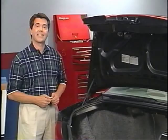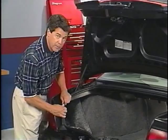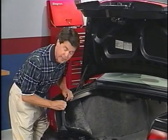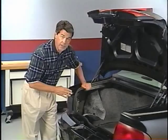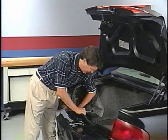Another less likely cause for water in the same area would be an incorrectly seated trunk weather strip seal here, where the flange metal overlaps. Be sure the weather strip is firmly seated on the flange. If you find a really considerable quantity of water in the trunk at either of the wheel housings, check for a missing body plug in the rear trunk panel.